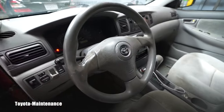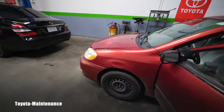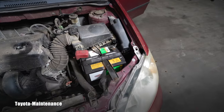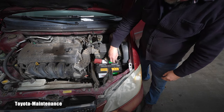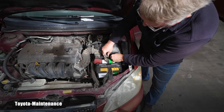If you are ever working around the airbag, you better go ahead and disconnect the battery. When you go to Toyota training, you clearly know you need to remove the negative terminal from the battery — make sure it cannot move back. Now you're supposed to wait 10 minutes.